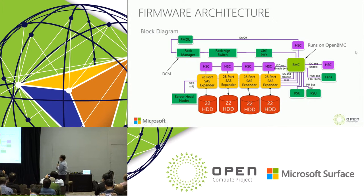For the firmware topology, the BMC is responsible for the whole JBOD management — it can get hard disk information from the expander, monitor the power supply, and monitor all hardware controllers on each board, as well as directly control the fans. There is a UART signal between the SAS expander and BMC for console redirection. The PMDU rack management can communicate with the BMC via a management switch for enclosure management.